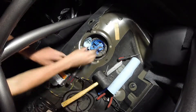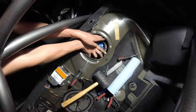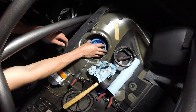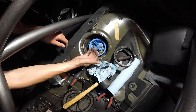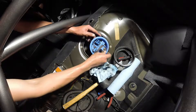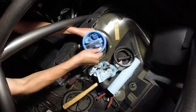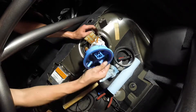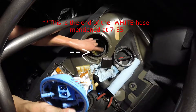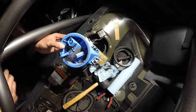There we go — let's see if we can do it by hand. Just barely. Go ahead and unscrew this all the way. There's the locking collar — you will save that. Now that you have the collar off, you can lift the pump out. There is an O-ring sitting inside the pump — if you don't grab it, it can fall into your fuel tank. Go ahead and just pull up on the fuel pump and snake it out. There's your fuel pump, and that's your gas tank, so don't spill anything in there. Here's your old pump. I'm going to put this to the side and then we'll move on to the other side and repeat the process.